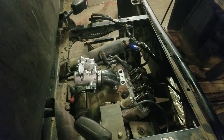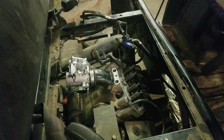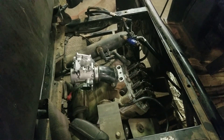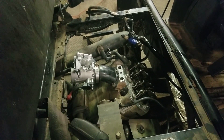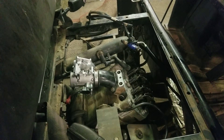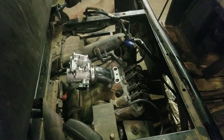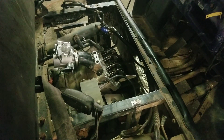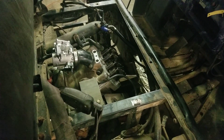I remembered that in the first video I had put in new hydraulic lifters. What I found out is that on the 700 engines there is an oil pump pressure relief valve — I didn't know about it. This is my third or fourth 700 build, and I know the 500 like the back of my hand, so I'm still learning the 700s. When I pulled the rocker cover off, the hydraulic lifters weren't pushing on the rockers and the valves weren't opening — so it wouldn't fire.